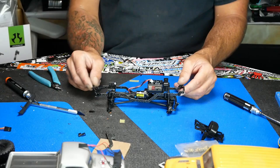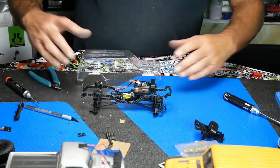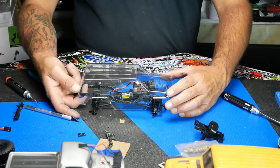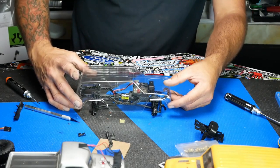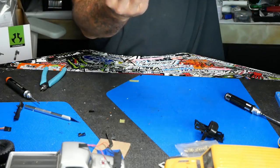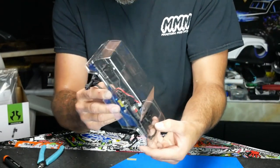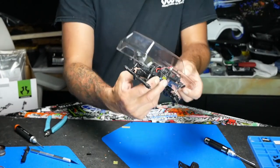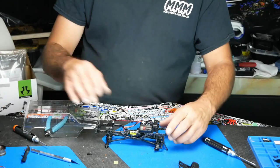So we have the rear crossmember — there's your little hinge. Looking pretty good. Body will sit on the truck. You can see we have a little bit of space in the rear, probably about six millimeters. We're going to have to space this guy back, and those four bolt holes should line up right below the license plate on center, which is pretty nice and simple to line up.